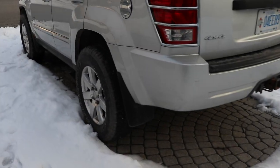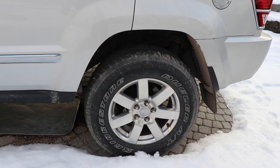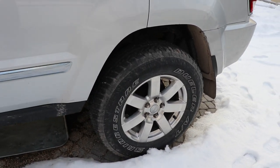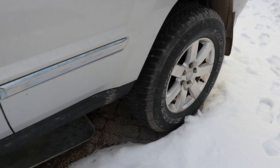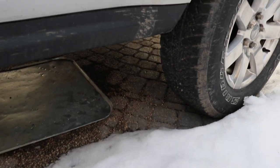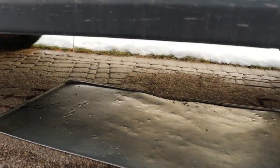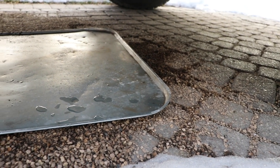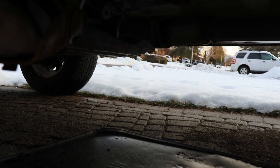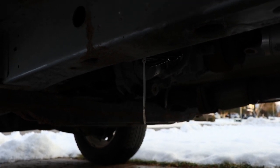This vehicle has got about a two inch lift on it and JK tires that are about an inch taller as well, so it's about a three inch lift total. If you had a stock vehicle you'd probably need to jack up the body to get the tank out — I don't think it would fit just sitting flat on the ground. The two lines are right here; I marked one with the zip tie to match the one with the red keeper.